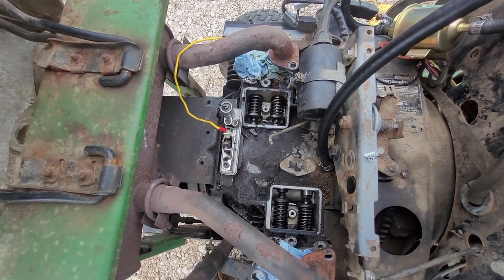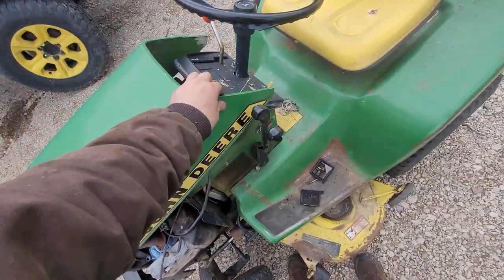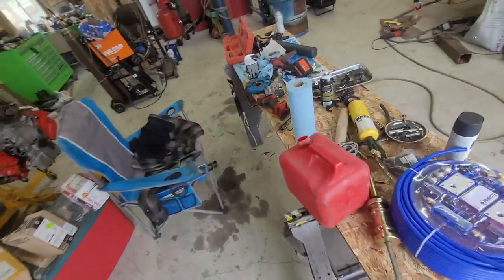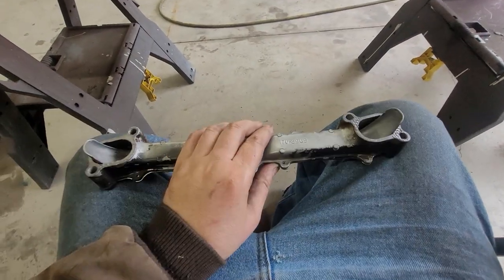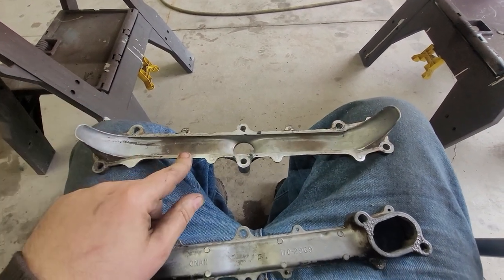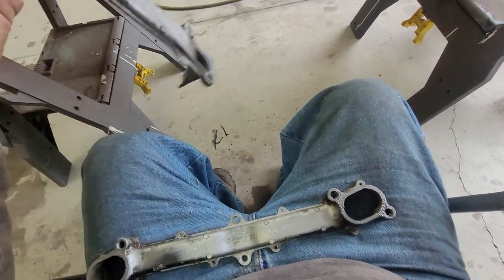The points seem okay — they look like they're new. I don't have a cover for the points. One of the problems I found was the intake. Apparently this is a big deal on these tractors — the rivets on the intake were popped. A lot of people online say they don't know why they made such a stupid design, but I do: it was a cheaper die to make. This side had rivets on it which actually looked like ejector pins to me, as someone familiar with die casting.